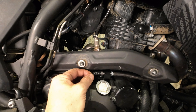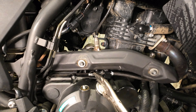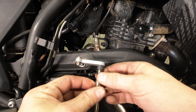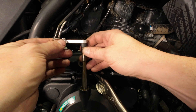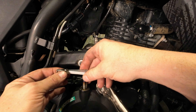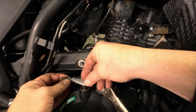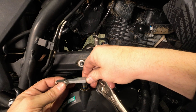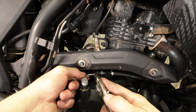Slide that back in — we have a little bit to work with here to get the arm on. Grab the paper towel out of the hole, take our arm and put a little bit of oil on here to make sure we don't chew the seal up, and drop this straight down. A little wiggle — don't force anything or you'll chew the seal up. Then you want to start turning it a little bit clockwise as it drops in. There's a plastic bit here, so when that is about a millimeter from the seal, you can turn it counterclockwise about 90 degrees and we're good to go.